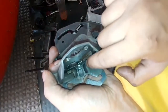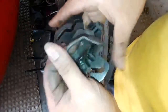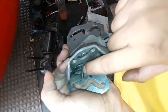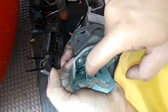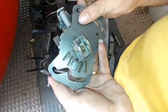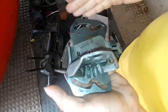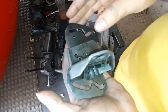On second, there is no half notch. Then there will be one more neutral, and one more half notch remaining — and that is first gear. The next thing to discuss is the cam plate.